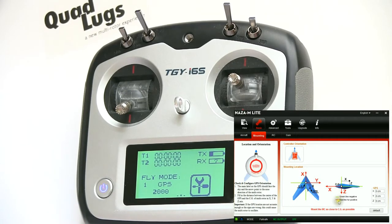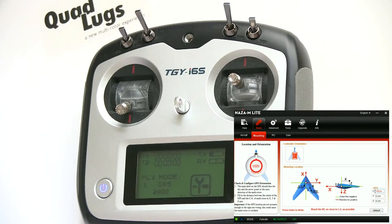It's in the forward direction and it's red, so we're going to use a positive number. In the wide dimension, the puck is straight in line with the controller, so the Y value would be zero. For the Z height, the puck is a little bit taller than the controller, so we'll call that two and a half centimeters. It's in the green direction, so that would be negative. Check the instructions if you installed the puck in a different area than we did in our build.